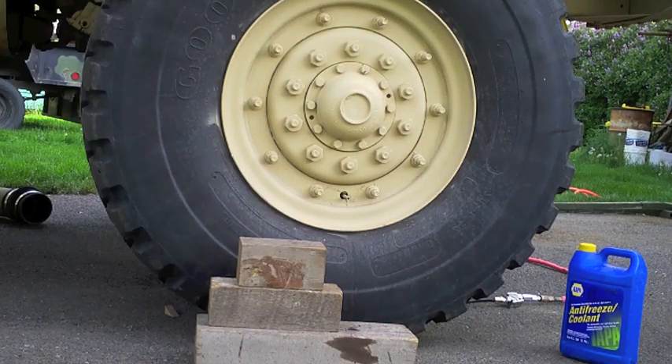And that's all there is to it. Fill the tire back up most of the way, then put the valve stem back in — careful not to let it shoot across the lawn — then fill it the rest of the way up and test her out. This is the minimum of what was recommended for the size of these tires — probably should have double what I put in — but I'm going to give it a test and report back. If it's not enough I'll come back and do it again. As you can see it doesn't take very long, not when you let the tire suck up its own antifreeze. If you're going to pull the tire off and flop it down and dribble it in with a funnel, you'll be here forever. This is the fastest way you'll ever see.